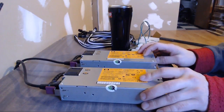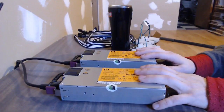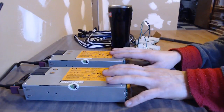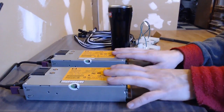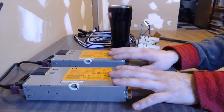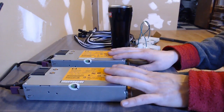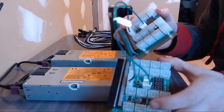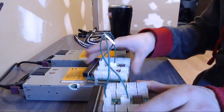It was very difficult to find a 1500 watt power supply both in stock that would also operate on 110 volt power. The ones I could get are about $400 a piece, which is not very cost-efficient. So what I have here are two Hewlett Packard 750 watt power supplies. Now, if you've read anything about miners you've probably heard that you can't run a single miner using two separate power supplies, and that's because if one power supply were to fail and the other continues to run, you'll be under-powering your device and risk frying it or possibly lighting it on fire.